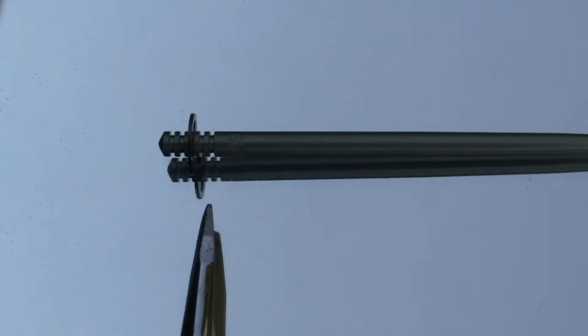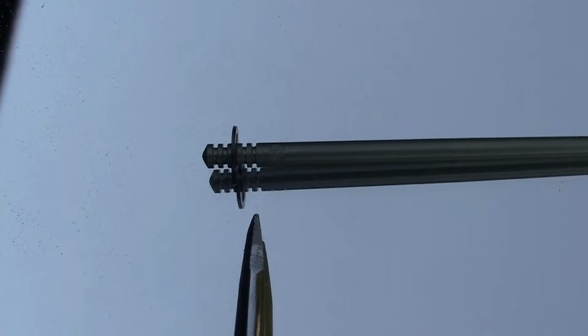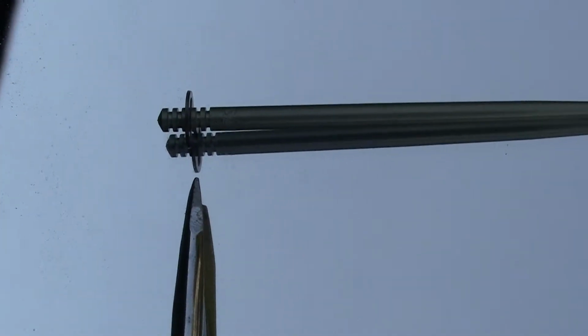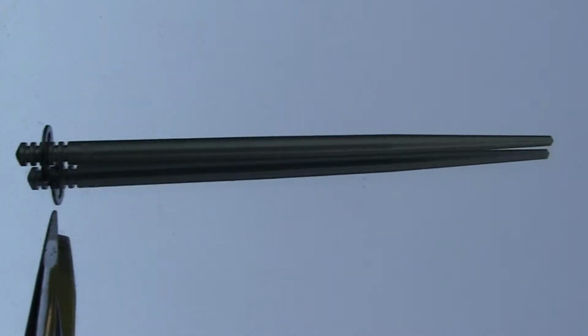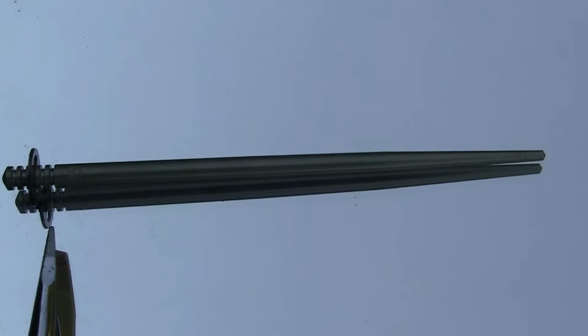Now I know this jet needle is not giving me enough fuel. So what I'm going to do is take this C-clamp right here and move it down either 1, or I'm going to move it down 2, all the way to the end. The 5th position. We'll call it the 5th. When I do that, the needle will naturally sit higher in the carburetor, and it will release more fuel,